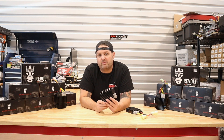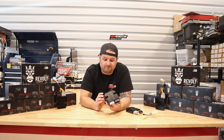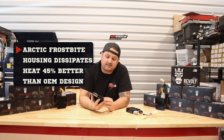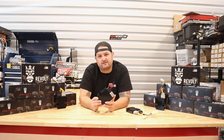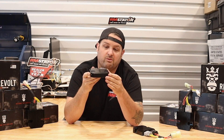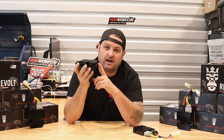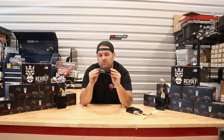We're seeing a massive improvement in heat dissipation versus all OEM and competitor parts, and we definitely put our money where our mouth is with a lifetime warranty on these to prove it. We have a CAD-designed CNC machined billet aluminum housing — our own in-house design. We figured we already had a really nice CNC housing we liked and had used on many of our regulator technologies in the past. However, since we're building a new part, we went ahead and redesigned the housing as well. We have a brand new aluminum housing with a changed cooling fin design. This regulator is not totally reliant on tons of air cooling like previous designs, but we also improved it while we're at it — lots of thinner cooling fins with much more surface area. The housing alone delivers an impressive decrease in temperature, pulling heat away from the electronics.